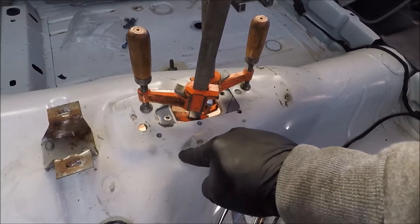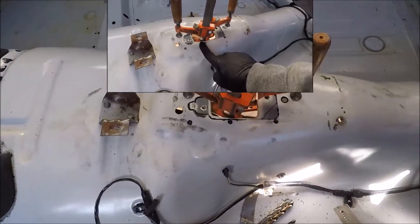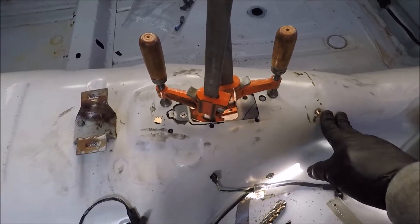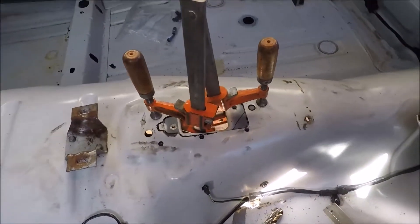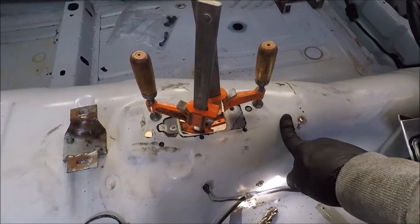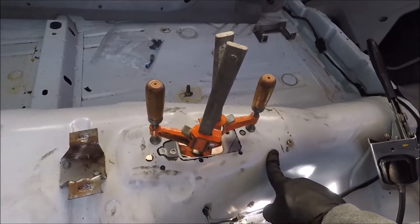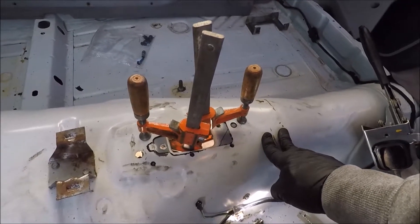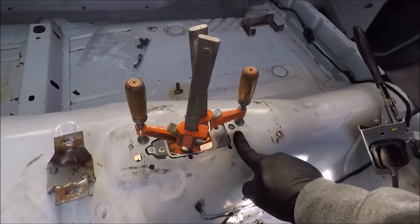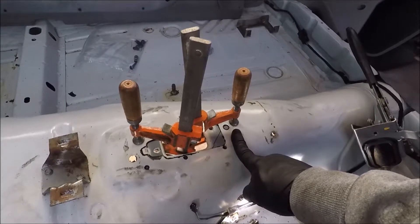I'm going to have to drill a half inch hole here to allow for the bolt to go through, and I'm going to trim a little bit of this off. Since I've got all these holes, I kind of hate the thought of having holes just left open. So I am going to whip the welder out, do some rosette welds, get this baby welded in instead. That means cleaning up the paint off any of these areas where I'm going to weld. I added another hole on the other side for an additional rosette weld just for strength, mainly because this rear hole didn't overlap this metal, so I wanted to make sure these metal pieces were mated together incredibly well.